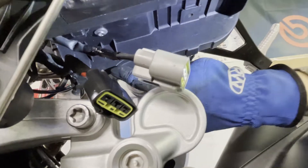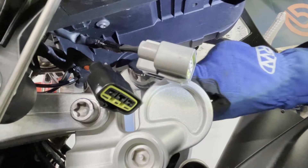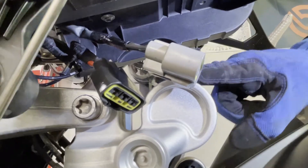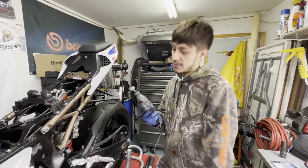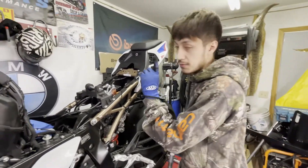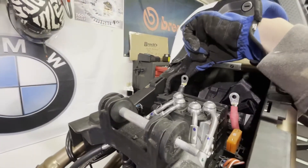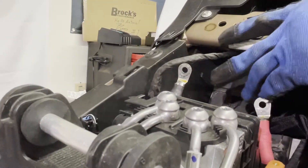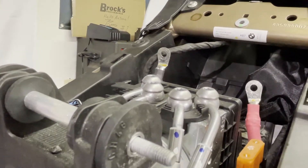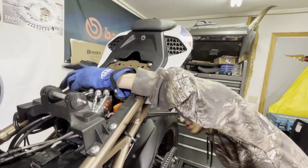Since that voltage regulator would have been banging into it, with configuration two we're going to have to dremel out a little rectangle in here so the top of the shock will be able to go inside of there. I've got my dremel with a cut-off wheel right here. Before you start cutting, make sure these wires are out of the way, because if you cut them that's going to cause pretty bad damage and you'll end up spending more than you want to on your project.